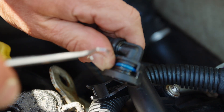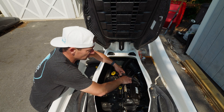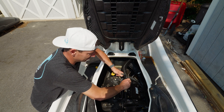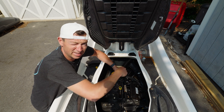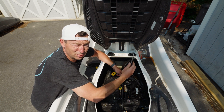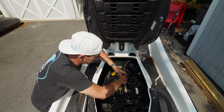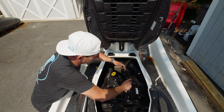There are a couple of O-rings — you want to make sure those O-rings are good. Getting this hose off of this fitting can be a real pain in the butt. Usually it almost feels like it's welded on there. You need to take a pick tool — this one is used for radiator hoses. Ideally a smaller version would be better, but this works. The trick is to get it in between the rubber and the plastic to get it off.